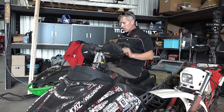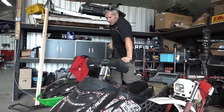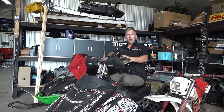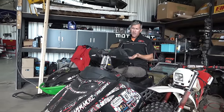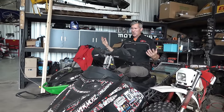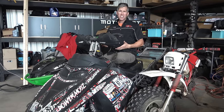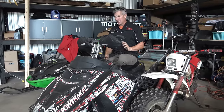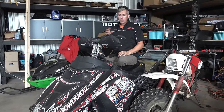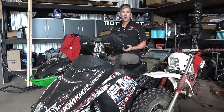You can just hop on it and give her a few pulls — feels good. Or even better, pop your spark plugs out and give her a good old pull. See what happens — see if anything comes out, if it's gobbed up in oil. Sometimes the injection system leaks and it gets really dirty in there, sometimes your crankcase fills up with gas. Pop those plugs out, put some new ones in, keep the old ones as spares.